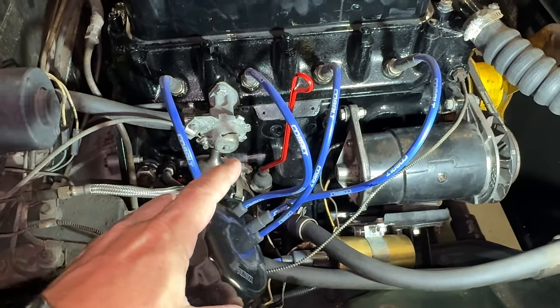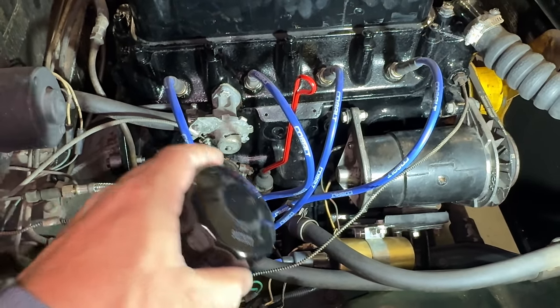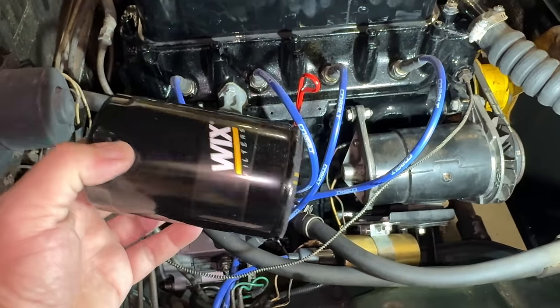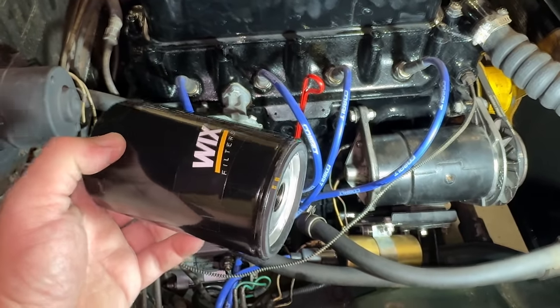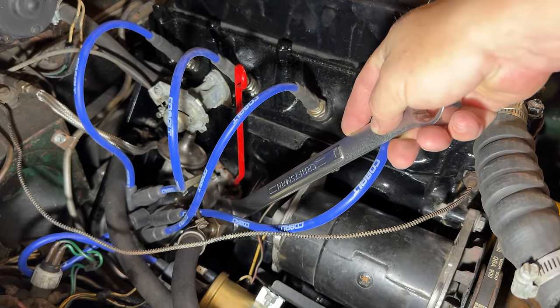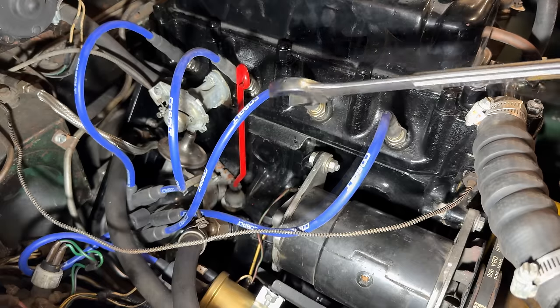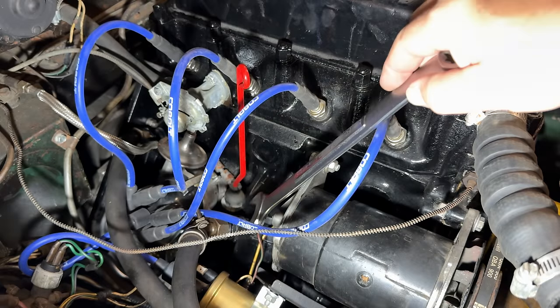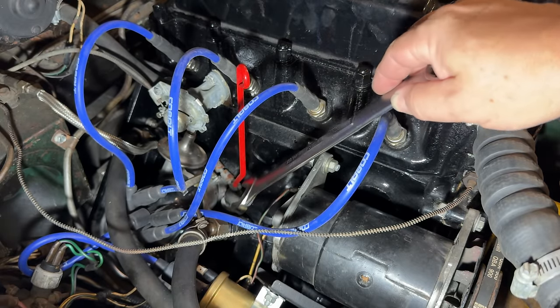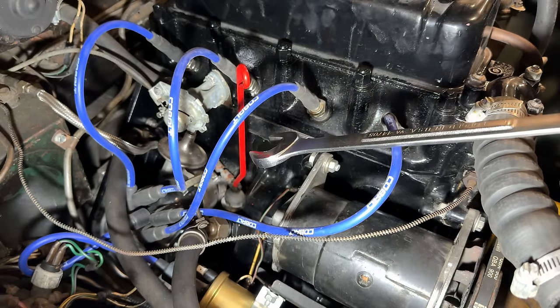It's totally reversible. Just take your canister parts, put them in a box and save them for later. I don't think anybody is going to fault you for using a more modern and better oil filter. Before I put the car up in the air to get the oil filter off, I'm going to remove this line here which goes to the oil cooler, because I won't be taking just the oil filter off — I'll also be taking off this adapter for the line for the oil cooler and replacing both of them.